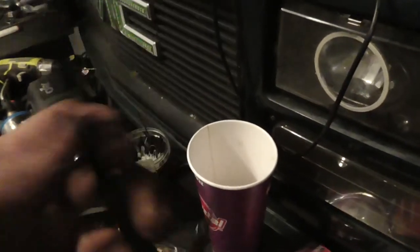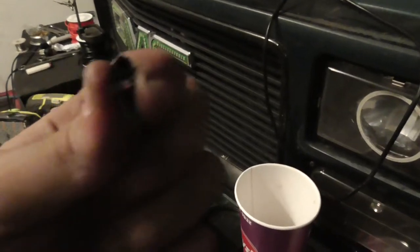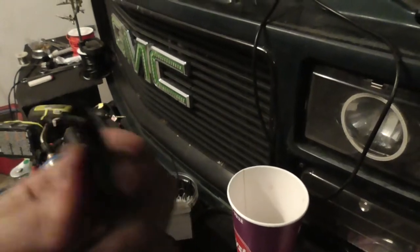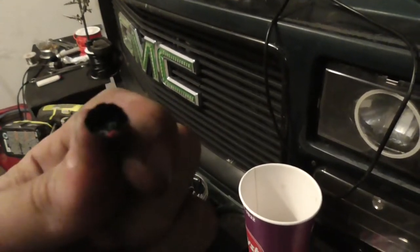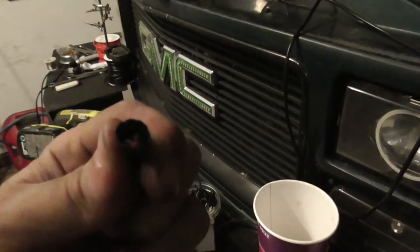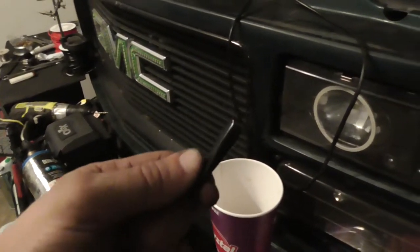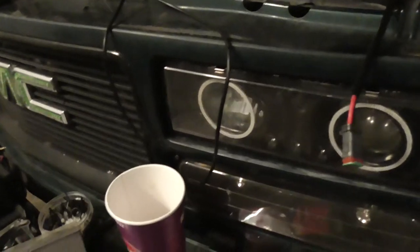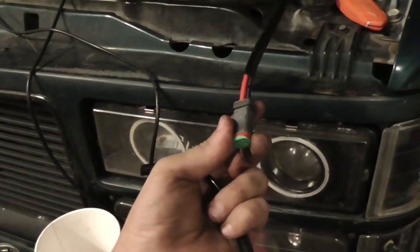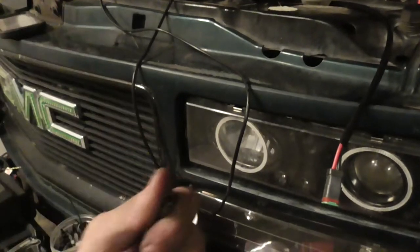These wires, on the other hand, you're not going to get a butt connector to splice and crimp these wires together and have them hold for any length of time. These wires are entirely too small for butt connectors. The only way I can see having a good tight connection on these is solder. Somebody might get this and think, okay, I'll just lengthen the wires, and then realize how tiny these wires are. If they don't know how to solder, they're SOL.